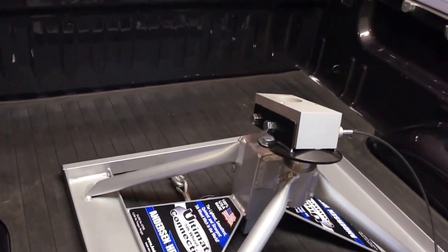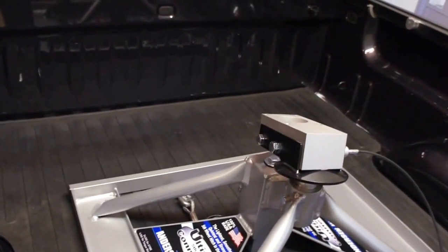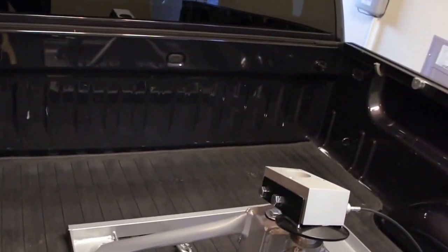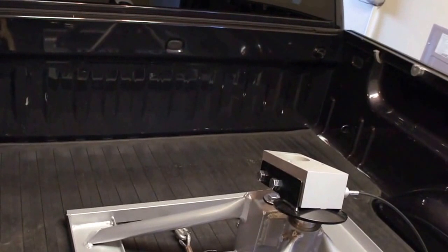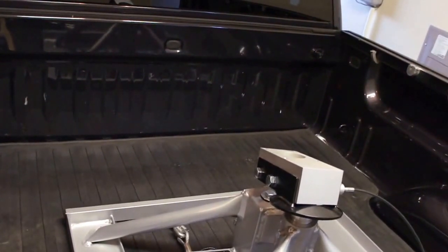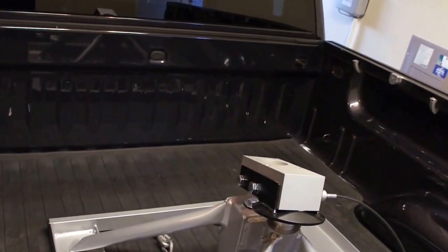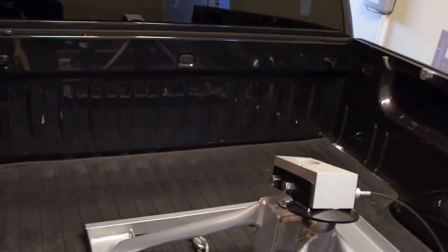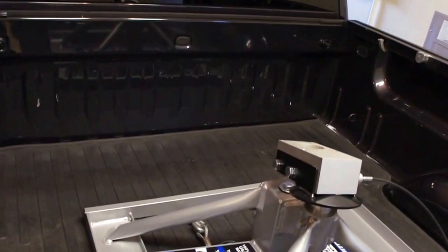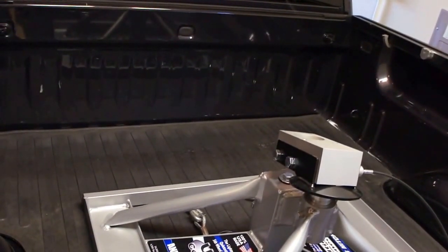So in this position, the front of my trailer is 8 inches closer to my truck cab than it is in the other way. And so for short beds, usually the instruction is to flip it around backwards so that you gain that 8 inches to help you with more clearance. In my particular case, I was dealing not with just the peculiarities of the positioning of the Andersen hitch, but also my pin box. I have a Wildcat.